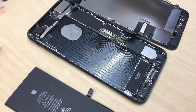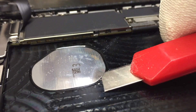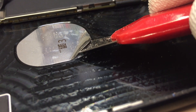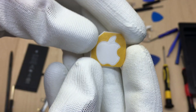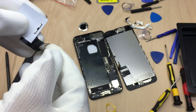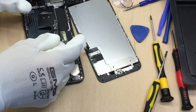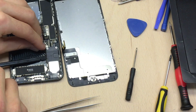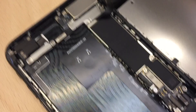After that, we want to remove the Apple logo. You can simply take a small kitchen knife, workshop knife, or flathead screwdriver, and just pry slowly on the Apple logo so you can take it out without destroying it. After that, exchange the original Apple logo with the translucent Apple logo provided in the kit. Peel off the adhesive to glue it into the phone's case, and then install the main PCB with the LEDs and the touch circuit. You can simply put that in between the battery connector — it gets sandwiched between the speaker and the case, so make sure everything looks exactly like in the instructions.